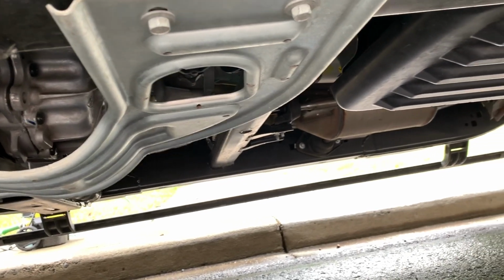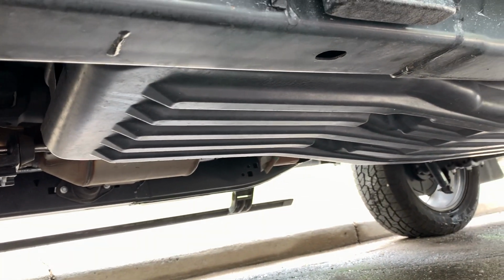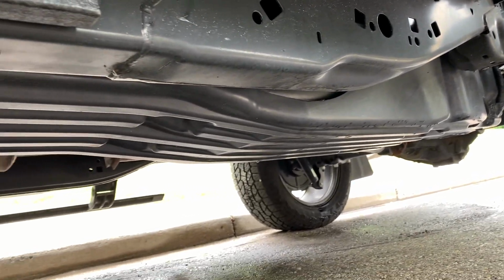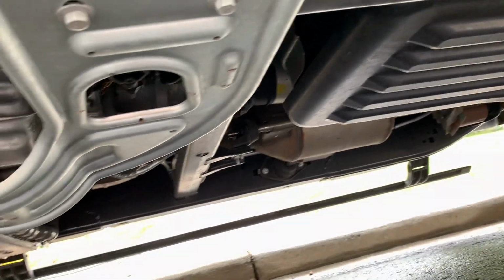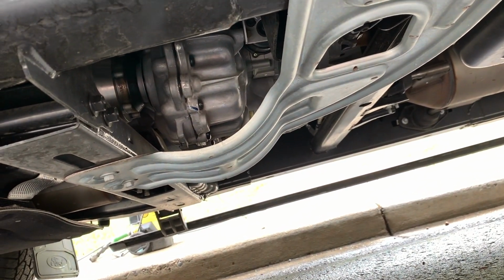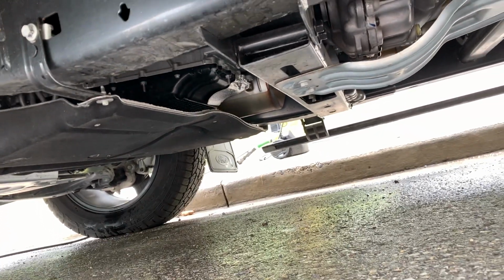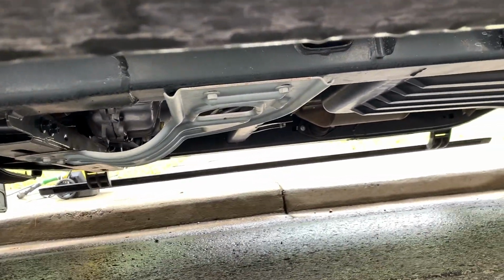I gotta say, my favorite part of this vehicle is the mileage, which so far I've been getting pretty close to 30 miles to the gallon on the highway. And how that's achieved is definitely from the 10-speed transmission, which is absolutely incredible. Going from a 4-speed overdrive RE4R 03A in the Nissan with electronic torque converter lockup in 4th and 3rd sometimes, and a tow haul, to a 10-speed with multiple modes: eco mode, performance, normal, tow haul, snow. Such a massive difference.